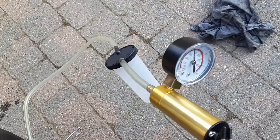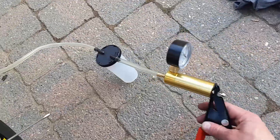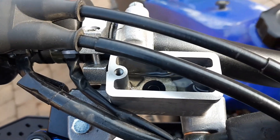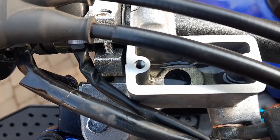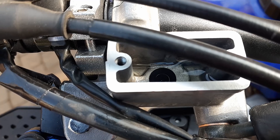The second way is with no high-fancy special equipment. Here you can see the level of the fluid is dropping. Attention: don't let it drop below the suction hole — this way you get air in the system, and this is not, I repeat, not what you want.